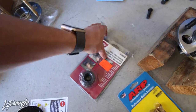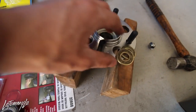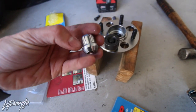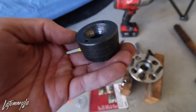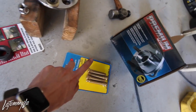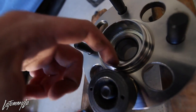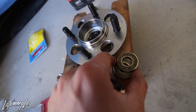Let me open this. I have these two washers - they go like this. And then you use an acorn lug nut, or I use a Muteki or Gorilla. It goes right in, impact it, and the whole stud will come in. I recommend using this because most of the time people don't and you can end up stripping the new stud you're installing. This has a bearing at the bottom so it just keeps spinning and won't mess up the studs. I also have this spacer for the front so the hub floats above and doesn't touch. The rears you could do it without it, but I still use these two washers just in case.